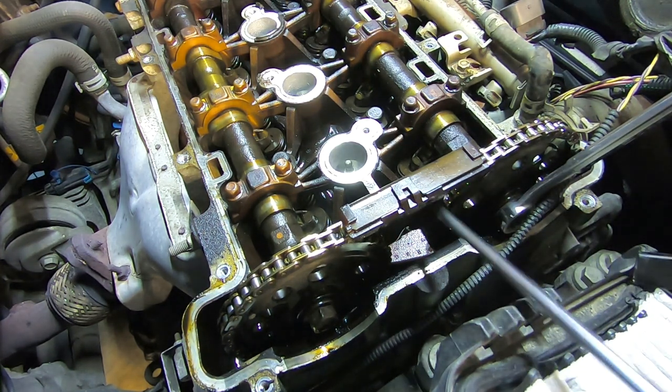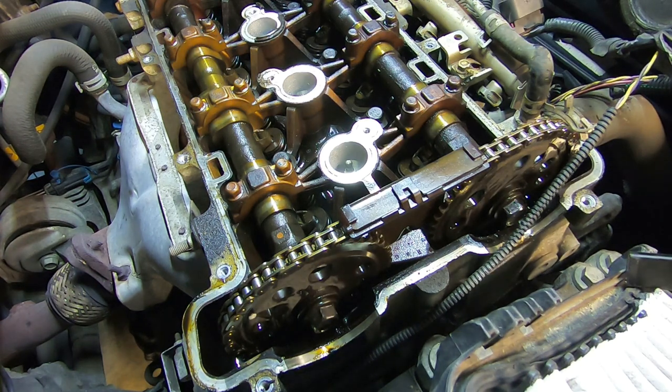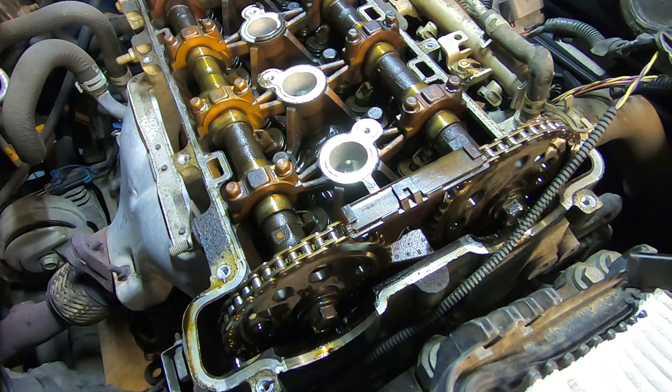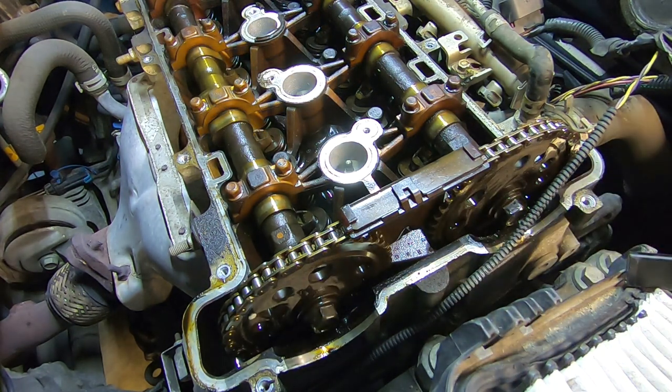You can see I've got all kinds of slack there — I'll move it back and get rid of the slack. In my opinion this chain is in perfect condition. It's tight and the timing marks are where they're supposed to be. If you take your valve cover off and you happen to see a lot of slack right here, it may be normal — turn your crankshaft in a clockwise fashion and the slack should disappear. Now if you happen to see slack down on this side, that means you have a bad tensioner and you do need to replace the tensioner and the timing chain.